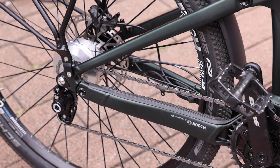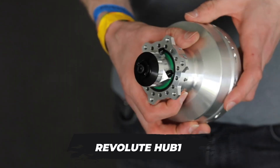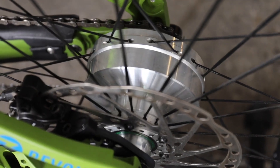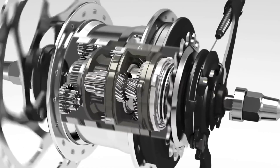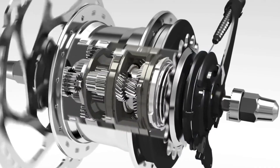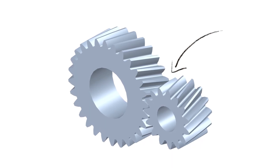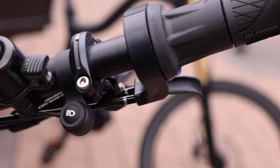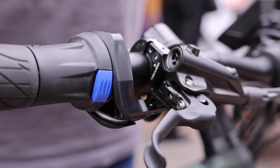The next hub on my list is a German-made six-speed hub by a company called Revolut. Their hub is called the Hub 1. It has a 400% gear range, it's made in Germany, and it's made specifically for e-bikes. One of their claims is that they're the only hub that allows you to shift properly under a large load. It's also the only hub that uses helical gears. One advantage of helical gears is that they're quiet and they distribute the pressure more along the entire tooth. The slight disadvantage is they're a little less efficient, which doesn't matter as much on e-bikes. By default, it doesn't spin backwards, which means you don't roll backwards on a hill if you're not pressing the brake, although it does have a neutral gear. I didn't get to test this out, but it's kind of an interesting approach.